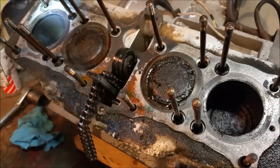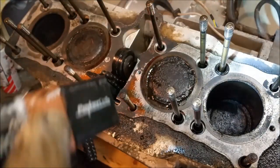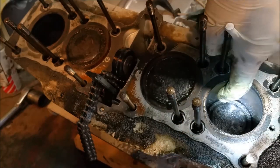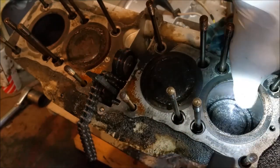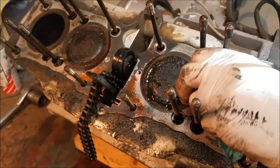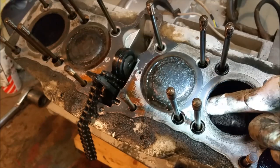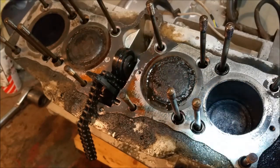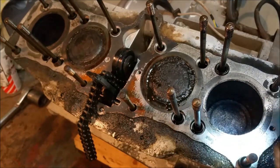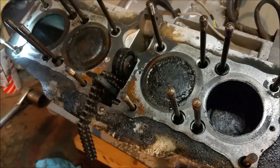You really could do some damage with the old bearings and all this muck. So I think it's prudent to overhaul. There's a bit of scratching there but not enough to bore it, and of course there's no lip. I think this bike's going to be a real keeper. When it's all cleaned up I don't even think I need to do any machine work — I think this is just going to strictly be rings, bearings, new gaskets and seals, and we're going to have a cracking bike.